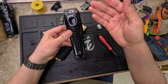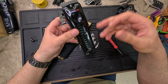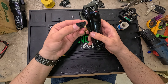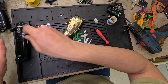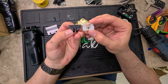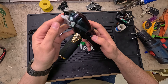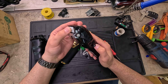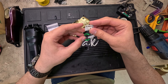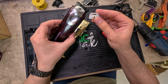The manufacturer of this clipper, which is a fake copy of a Babyliss clipper, said they manufactured it for barbers' use. Barbers like high RPM, so they didn't pay attention to this important part. This pin drive has the exact same design as this one, but it's used in a home-use clipper where the RPM is pretty low. This pin drive will last much longer because the RPM is low and the blades are a little bit lighter, so it will work much better.